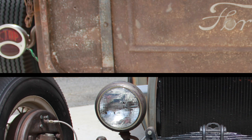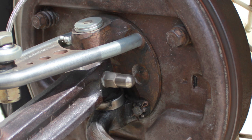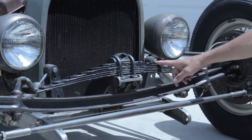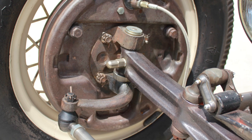It cost me $5,000 to build this whole truck in eight months. I'm running 1940 Ford front brakes with the round-back spindles. The axle is a Model A stock straight axle. The front spring is a reverse-eye leaf spring, and I have the frame set up as a suicide front perch. The spindles are installed backwards so that the tie rod is up front.